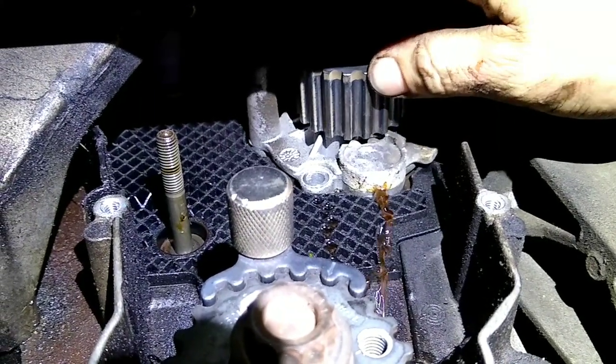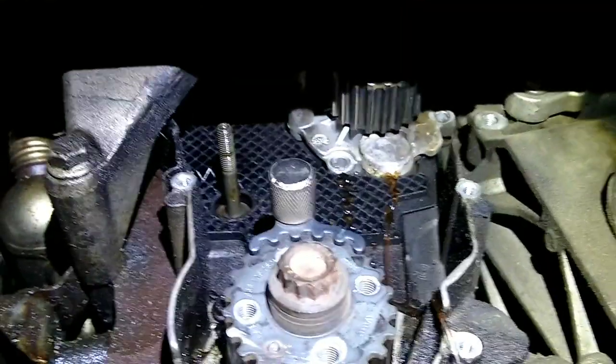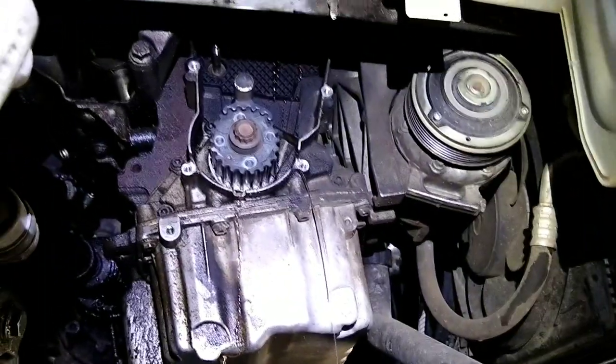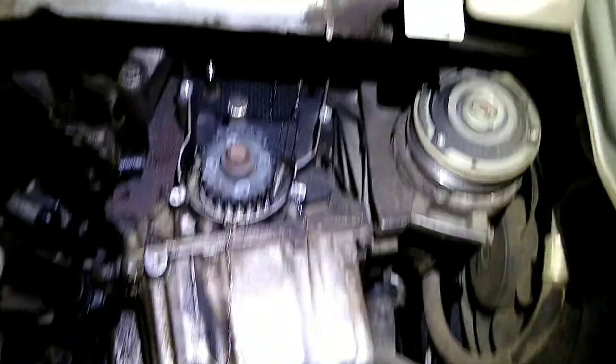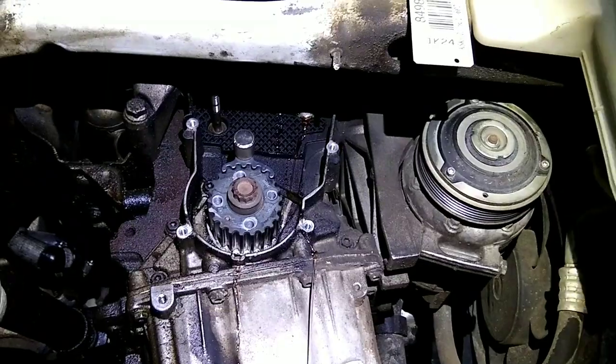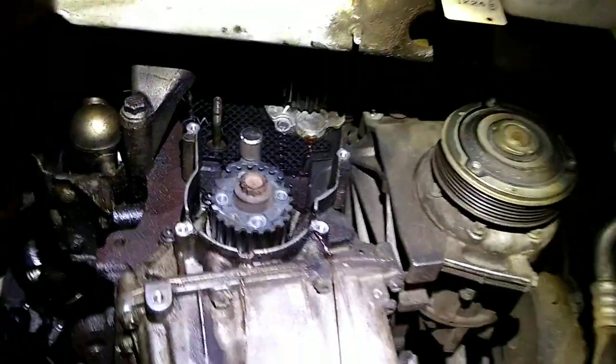And it's best to just let it drip out like that. That's about what you want. If you don't, it will drop a gallon of antifreeze right on your face. Or if from up above, it'll still be everywhere. So definitely let it crack open and let it drain out. That would be my advice.